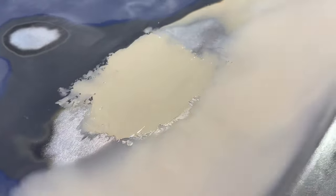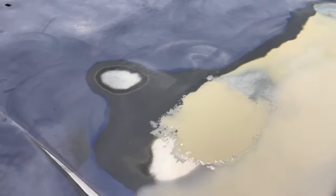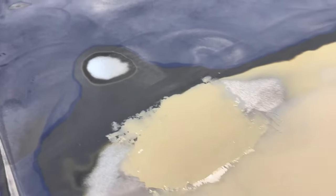So that's the dolphin glaze on. I should have originally put it on with the original filler that I'd put on, but I just didn't notice it until now. But that's on. It's obviously not the best skim, but this just gets sanded away smoothly.